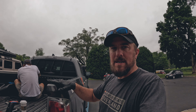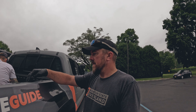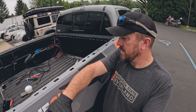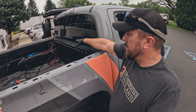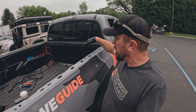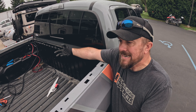Specifically, I'm working on waterproofing under the bed caps. Last time I put a canopy camper on here, I didn't do that and got some water intrusion from the sides. Now that we've had so many of these canopy campers installed, we're going to take a bead of Sika all the way down on the inside edge, close to the outside edge near the cutouts — we don't want Sika to come off on the paint. Along the front edge, we'll run a bead of Sika, and there's a significant gap we'll fill with butyl. You don't want to cap off the drain plugs in the bottom of the bed — if you get water in there, it needs a way to escape.